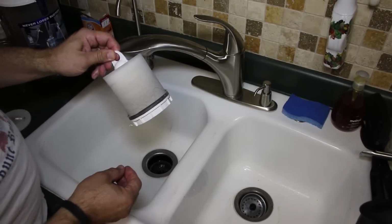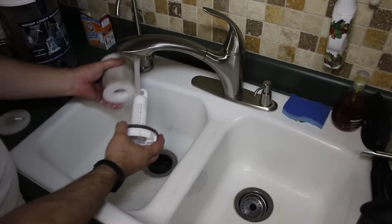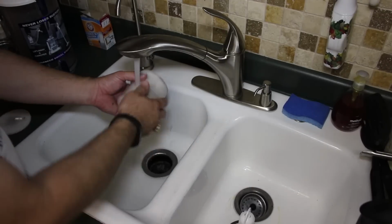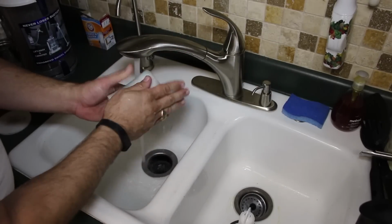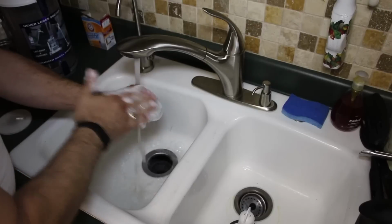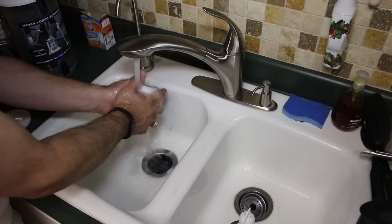The next part you want to clean is this other foam filter they have. So rinsing it off, if you'll notice, doesn't do enough. You can pull this foam piece off of here, rinse off this white plastic piece, put that aside. But this one you're going to want to use a little bit of soap. I use dishwasher detergent. Go in there, scrub it, and use it like a regular sponge. Get it all working in there. Scrub it in order to get all the dirt and stuff out of there. This will help your vacuum cleaner clean a lot better.